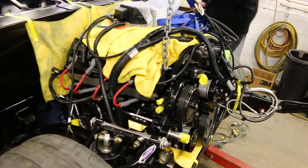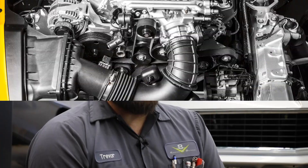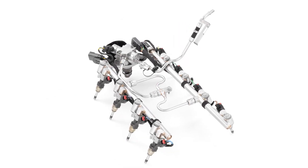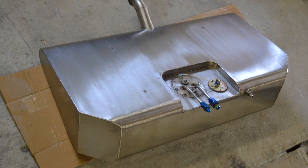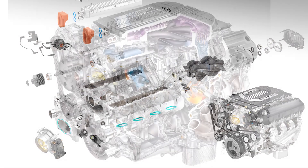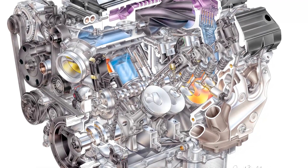The installation of the engine was pretty clean, as these LT4s are designed to fit in the tight confines of a modern Corvette. One of the biggest differences between LS and LT engines is that LTs are direct injected, similar to a diesel — there are no injectors in the intake runner; they spray right into the combustion chamber. This means much higher fuel pressure. In order to combat cylinder pressure when ejecting fuel, you've got to run quite a bit of fuel pressure, which is why there's an injection pump on the back of the engine that steps fuel pressure up to somewhere between 1,000 and 2,500 psi depending on conditions. The pump in the back of the car runs at around 80 psi and is pulse width modulated like LS cars, so it only runs as hard as it needs to — and GM runs it as little as possible while still maintaining much higher fuel pressure than in the past.